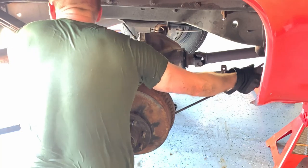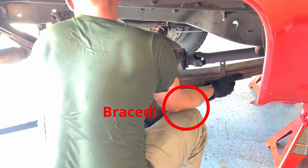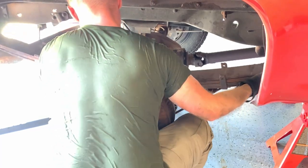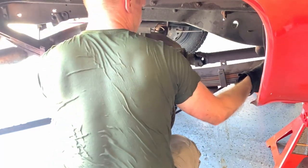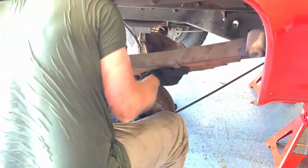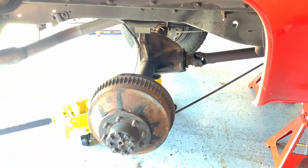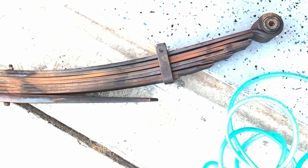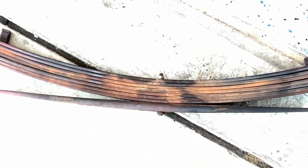Come in and very carefully with your arms braced, start to lift the spring off of the axle. You want to tilt it to about a 45-degree angle towards you and then start pushing it towards the back of the truck. That'll allow you to pull the short end out and very carefully get it around your fender well. Again, we can see the leaf spring we took off — the bushings themselves are in terrible condition, and the spring obviously looks like it's in terrible condition too.